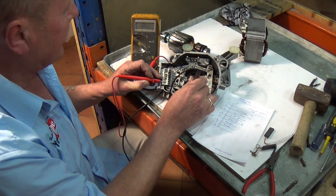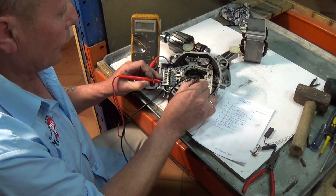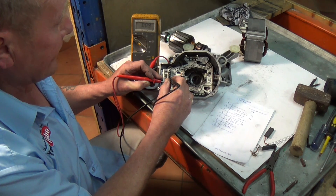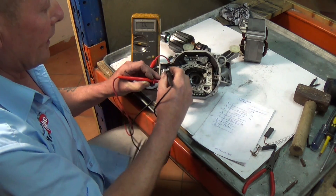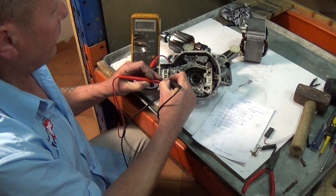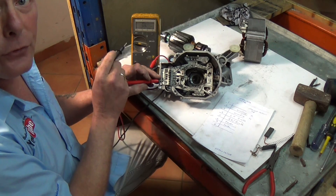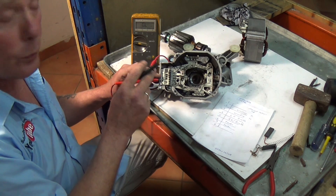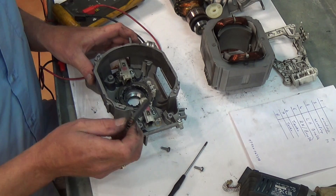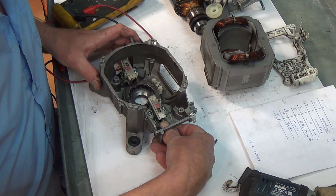When we put the meter on the other side it doesn't matter which side we touch because it's only a field - we have continuity on both sides. Going across the two tachometer terminals we should get a reading. We've got 0.9 there. We can turn it to ohms to get an understanding of the winding size and we've got 15.4 ohms. What happens is when the armature is rotating this gives a different reading as the speed changes, and that's how the computer understands what the motor is doing.